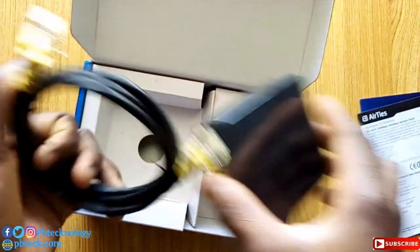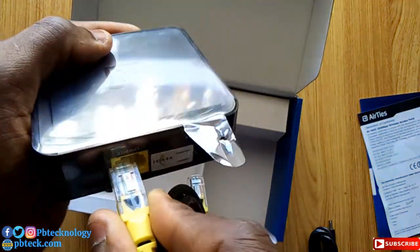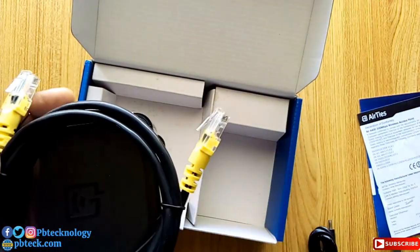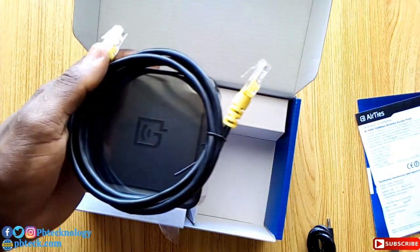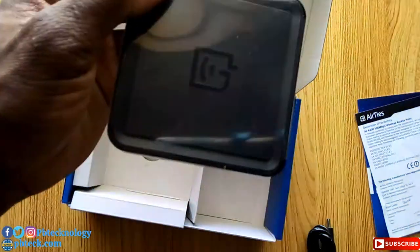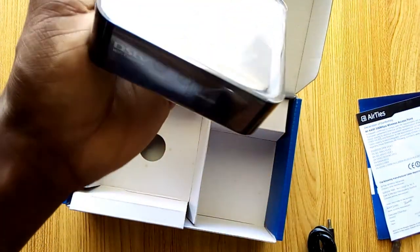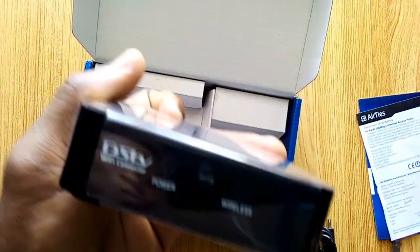You connect the Ethernet cable to the Wi-Fi connector, and the other end to the DStv Explora decoder. To get Catch Up, Max, and Box Office on your DStv Explora decoder, you need to connect the DStv Wi-Fi connector to the Explora decoder. This also enables you to do recordings on your DStv Explora decoder, so it's always important to get this Wi-Fi connector.